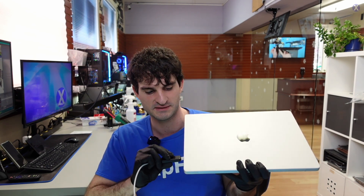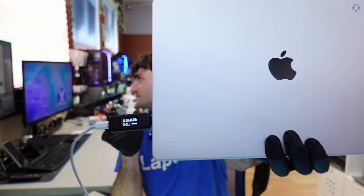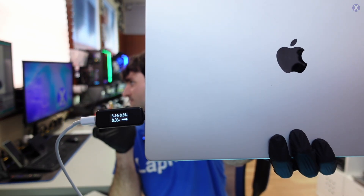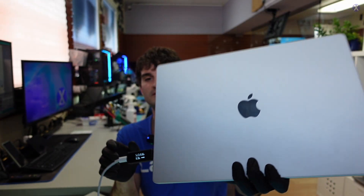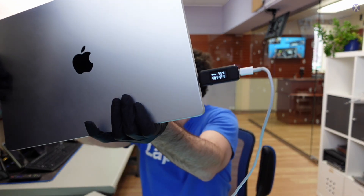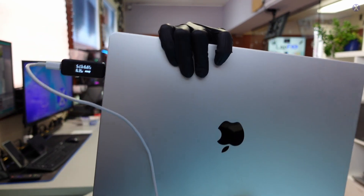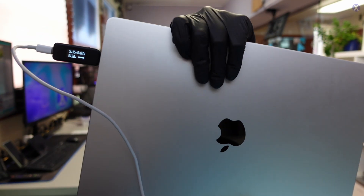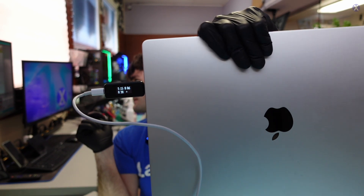Let's see what's going on with this one — it has no power. Let's plug it in and see what we get. So we have our USB-C tester and we see about five volts, 0.07 amps, 0.08 amps. That was the case for every single port. It's good to measure that because if you measure it and you see something different going on across different ports, they can indicate different things — that's why we always like to check that.